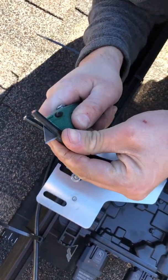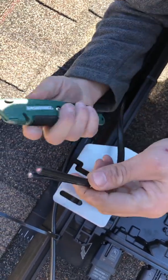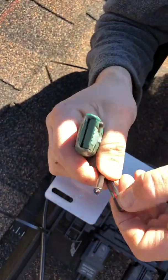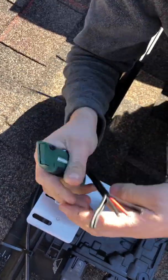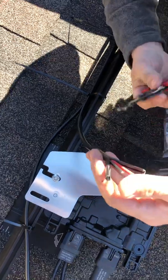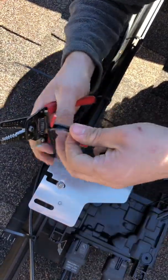We're going to take the knife and cut the insulation and divide the wire. We need to cut off about that much, then peel the jacket back on both sides. Use the wire strippers and cut the ends.